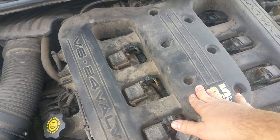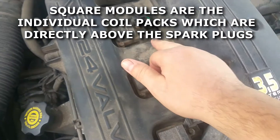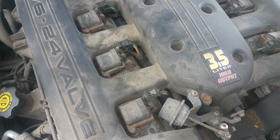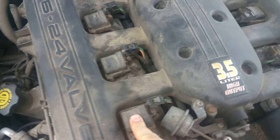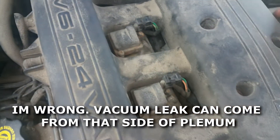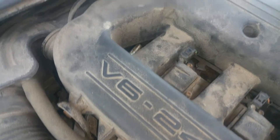This is a plastic upper intake manifold. Number five is getting air from this runner — this runner feeds cylinders six, five, and four, and this one feeds three and one. The air for number five is coming from this side, and right under this bolt is the end of the intake runner for number five, which runs down along here into the lower intake manifold.